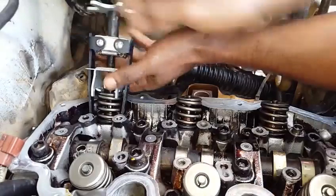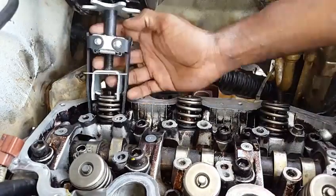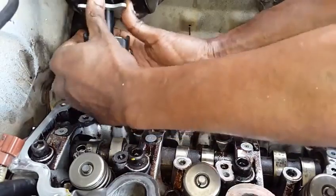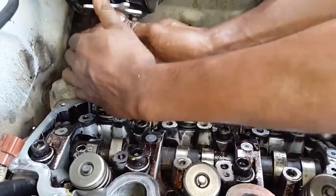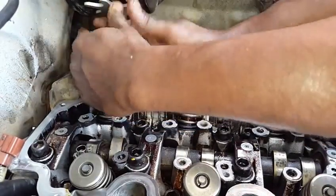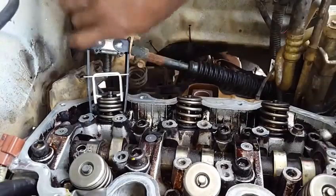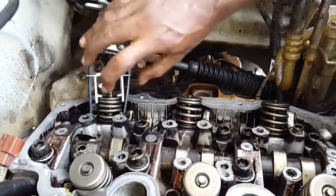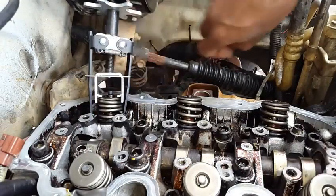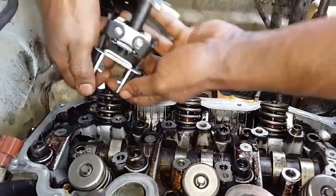This is actually a plus for us. We're gonna have a little hard time but we got the tool to fit in there, so we just got to compress it. This one is not your norm. I'm getting the spring to compress and you can see the position you have to put your hands in. But this here is extremely tight so we have to be careful we don't bend the valve stem. This side didn't actually grab the spring, so that's why we're having this problem. Let's reset the tool and take a second try.